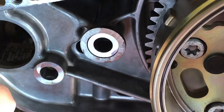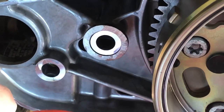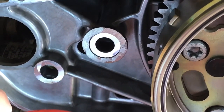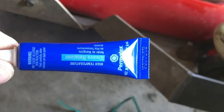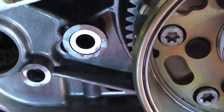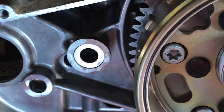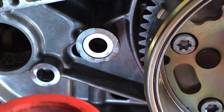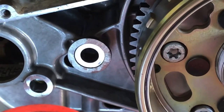I really think it's got to help quite a bit. I haven't driven it on yet because I just want to do it one time. I'll get a little green compound on there, peck it on until it's good and snug, then let it set up 24 hours — that's what the compound says. I'm using Permatex brand, it's a high-temperature sleeve retainer, good to 400 degrees, which should be plenty. I've not seen anybody do this — some people weld a piece of aluminum in the case, but I'm hoping this is a quick and easy way without any welding, because my boss is still good.